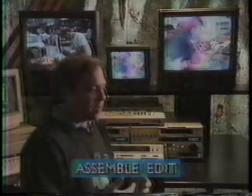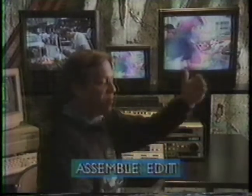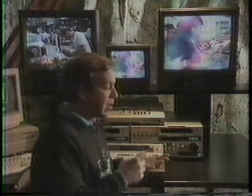Assemble editing is simply for recording a scene, recording another scene, recording another scene. Every time you do an assemble edit, the sound and picture and everything is recorded. And here's where it gets interesting. By everything, not only the sound and picture are recorded, but the machine's internal control track is also recorded. As the machine is making an assemble edit, the master erase head is erasing tape as it's coming out of the cassette shell before it goes over to the video heads, just like a normal recording.